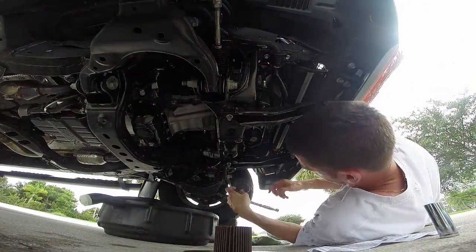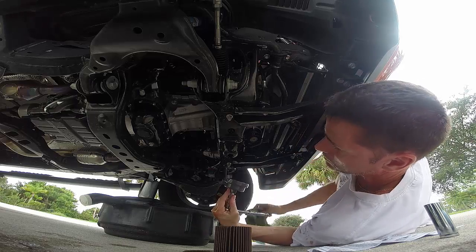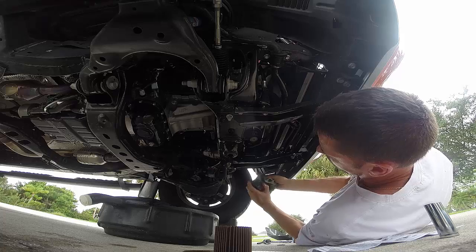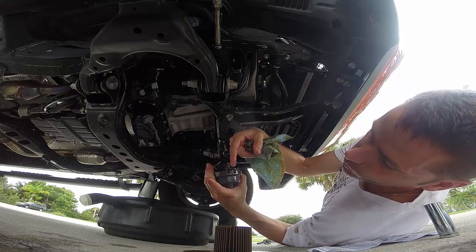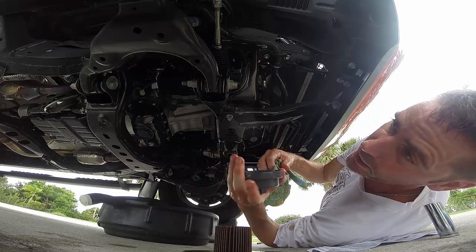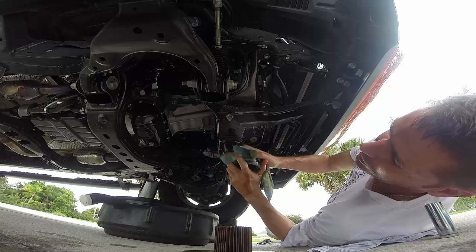Okay, I have the filter casing back on, and I just wanted to point out with this wrench, the reason it kind of got stuck on me is because I wasn't really paying attention. On the filter housing, there's slots that come down either side. One side has these 3 slots you just align with this on the wrench, and the other slot has a single. So if you align it correctly, which I didn't do, you won't have problems with it sticking on like I did.